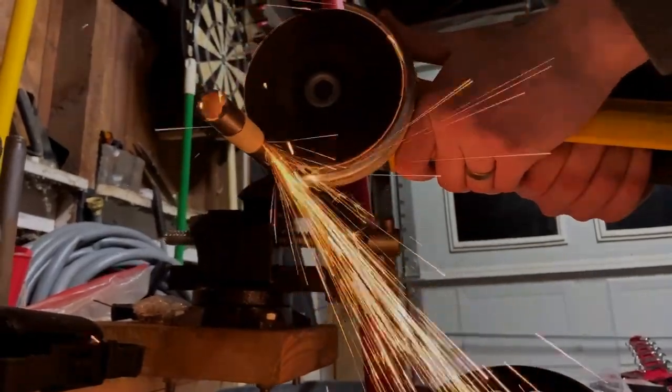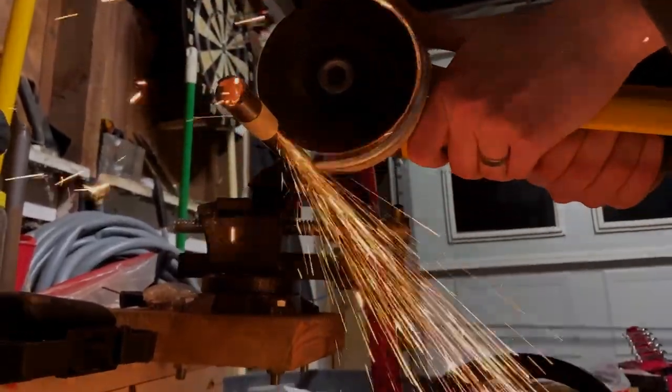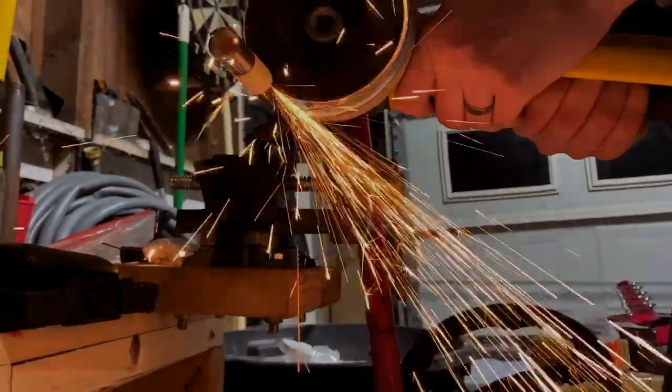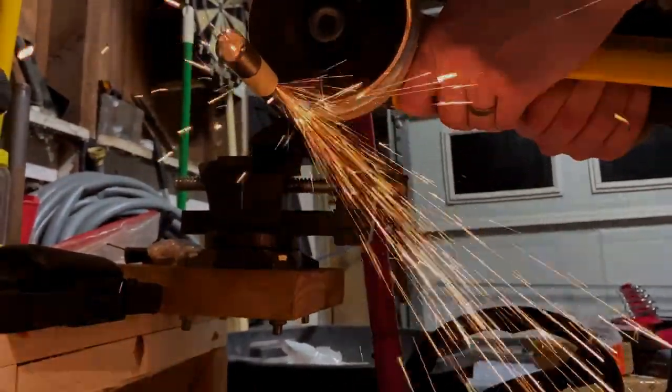Okay, so I just wanted to pause here and explain something real quick. Everything that we're doing right here is not actually what ended up happening. Those knuckles with the nut, that was just a dumb idea. Obviously, there's too much play or too little play to be good enough for steering. It just kept binding up everywhere.